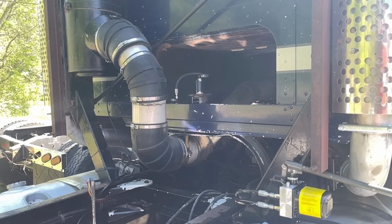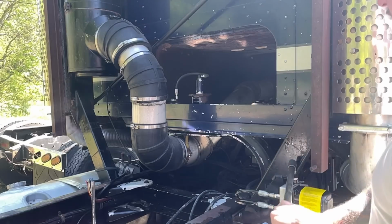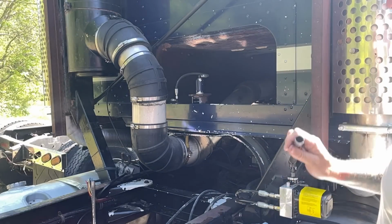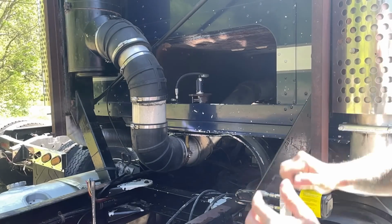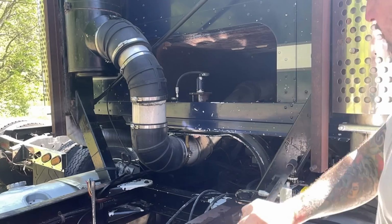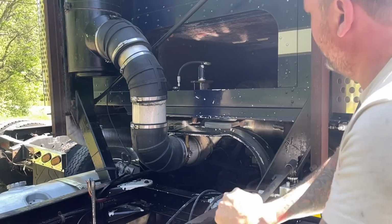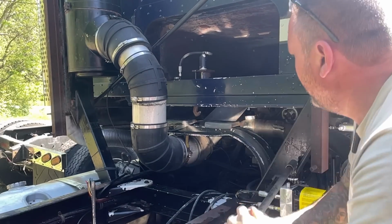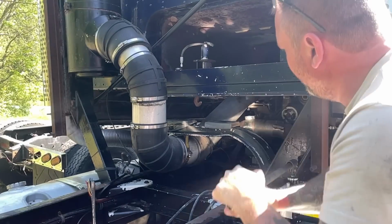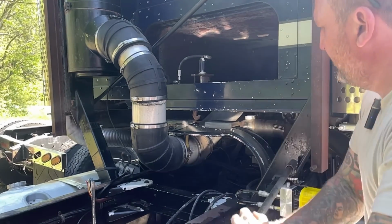All right. See, can you see the pump here? Yeah. All right, so we're going to put this on up. Should start pushing that cab latch down. There it goes. And then it should start the cab up. Couple of hard pumps. There it comes. Okay, now I should be able to move this down and the cab should come down. Yep. So definitely was the pump.